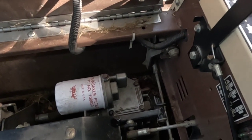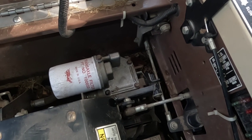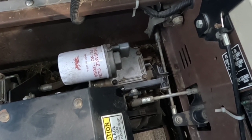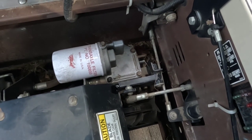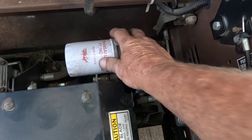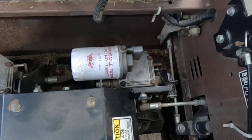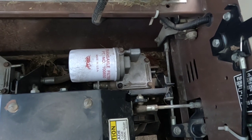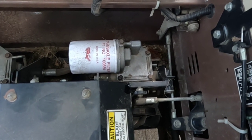We're not really going to tear into this mower, but what I'm going to do is a video on a problem I've seen on a few of these. And if you don't know what you're doing, you're probably going to determine that this transaxle is bad, that the hydrostatic drive has failed. What we really need to do is actually an inspection. I've already fixed it on this mower — it was on this side — and we lost right-hand transmission drive. It started getting where the right side was slower and slower and slower. He and his brother actually serviced and changed the fluid in the transaxle, and I didn't get it until it spun down to the point where the right side would just barely move.